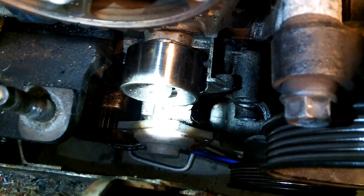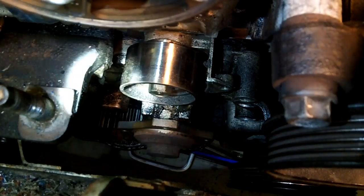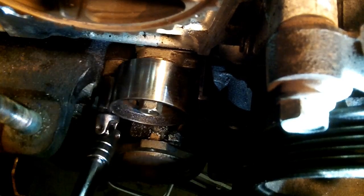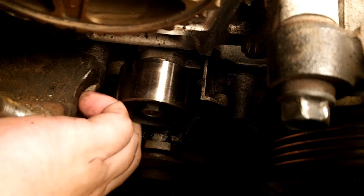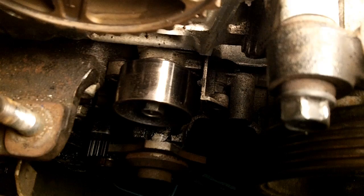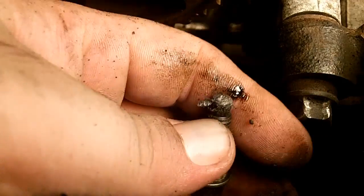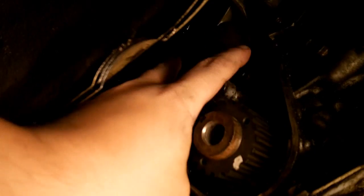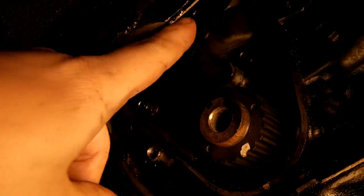And there's your water pump housing. Now that you have that big pulley out of the way, you can actually get to the bolts to get the water pump off. It's like a bunch of junk. It's RTV. There's RTV around in these threads. Alright, that's one. Alright, next we need to get these two bolts and that bolt, which go up to the water pump, which is kind of up on that area.